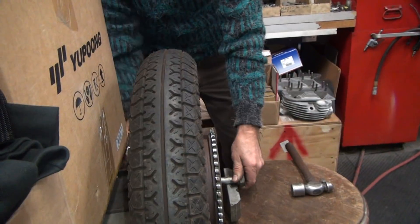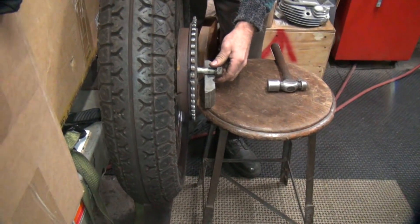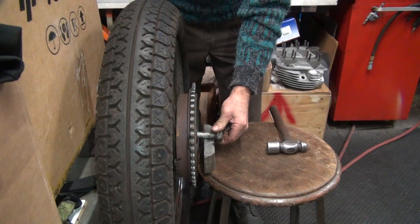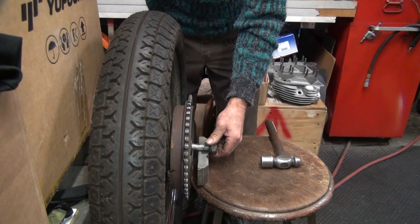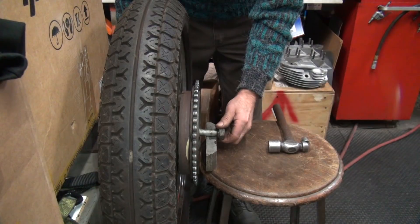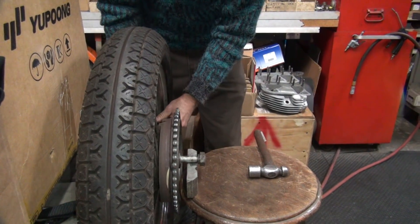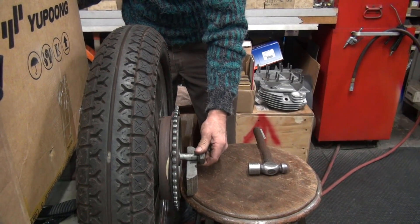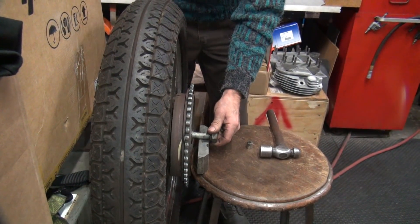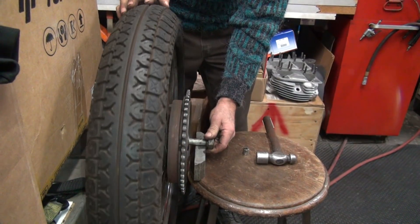So this — the wiggling finds the heavy part. There's bearing drag, so the wiggling overcomes the bearing drag. It's a little close under here at the stool too. The wiggle allows it to center itself, and then you put the weight on the other side. It appears the heavy spot is on the bottom. I don't know why it does that — gravity is pretty cool. You do it 90 degrees. That's the weight we had before — see how it's too heavy? That's gonna be pretty damn close. That's awesome — turn 180, check it again.